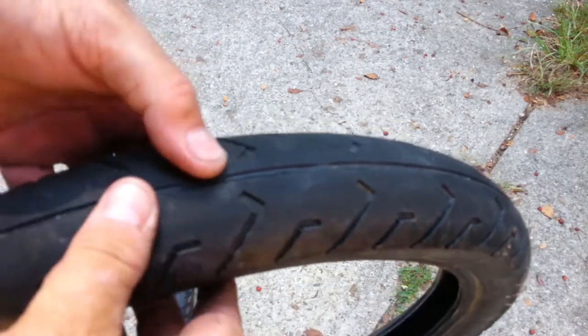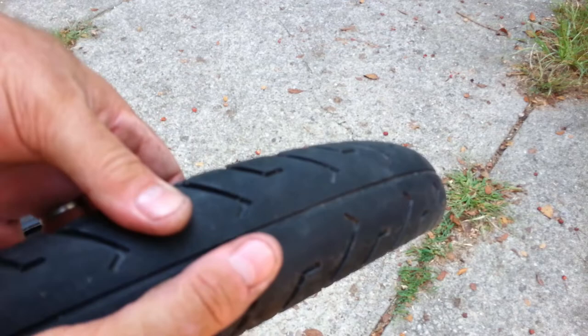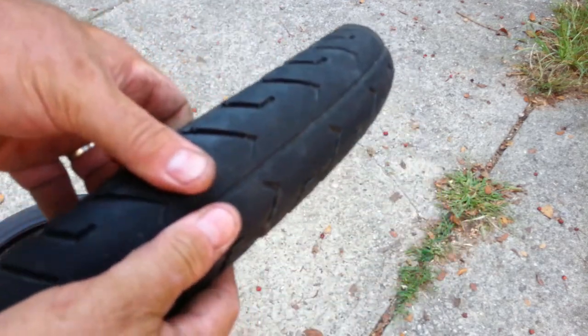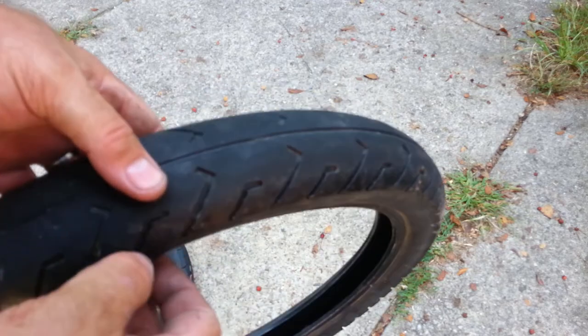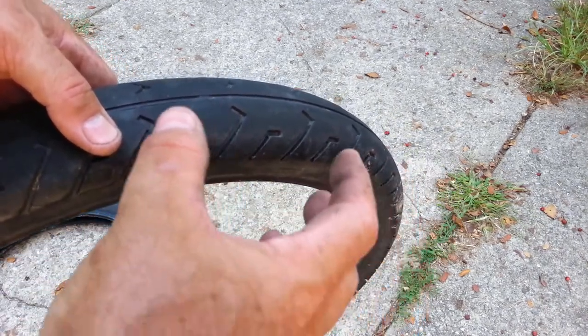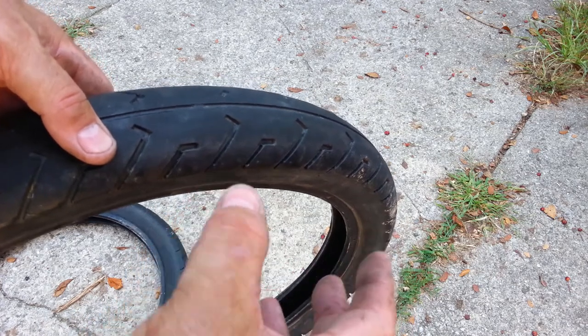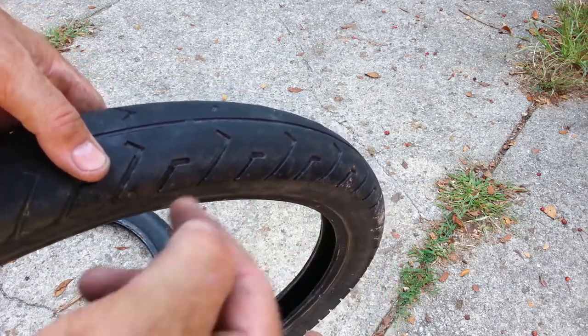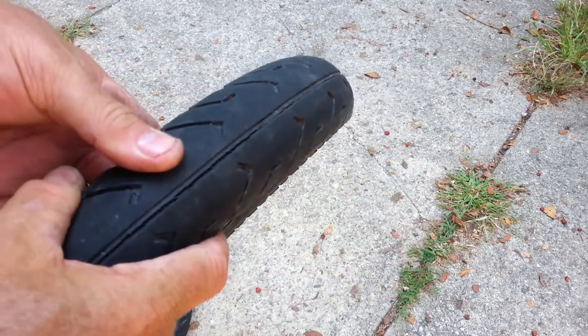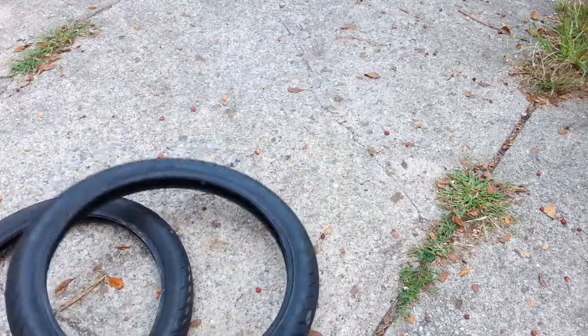Look at that. This thing had a Weeble Wobble in the front end. In addition to the play, it had a noise, kind of a whoosh, whoosh, whoosh noise, which may have been this tire, but when I had the wheel off, there was a rust rim around the outside of the inside of the drum, and I wire brushed that all out, so I think I had a little bit of brake drag going on there. Anyways, she's better now.